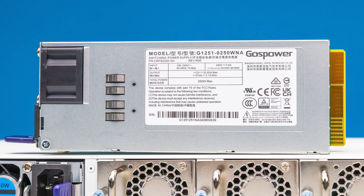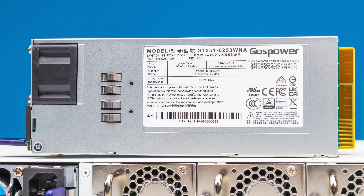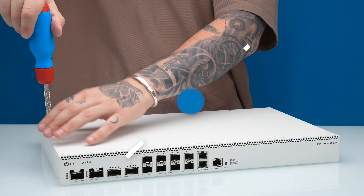The other thing is they're only 250 watts. If you look at a larger switch, you'll easily see 1.5 kilowatt power supplies — sometimes more — so you may have two 1.5 kilowatt PSUs in a larger unit. These are only 250 watts, which is probably less than a lot of folks' desktop processors.